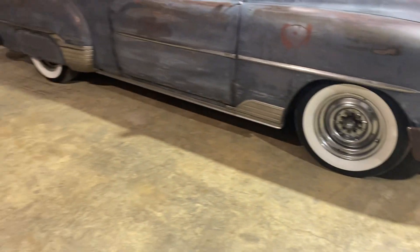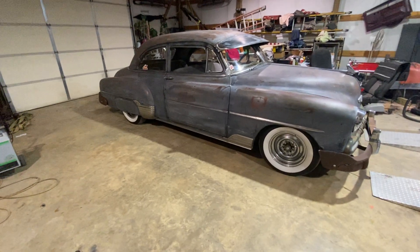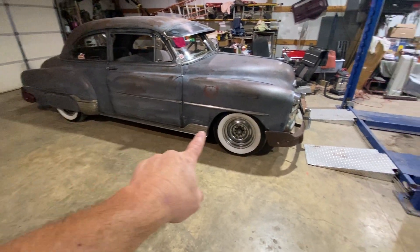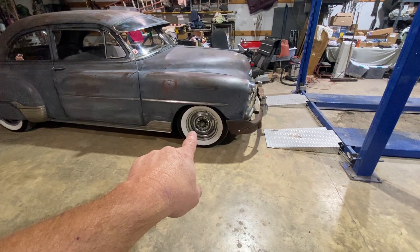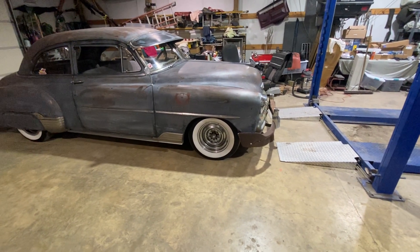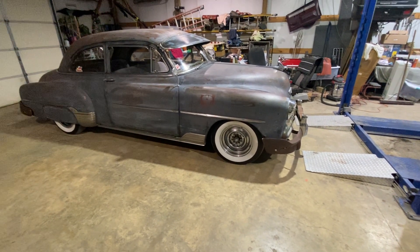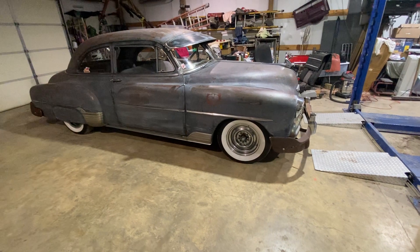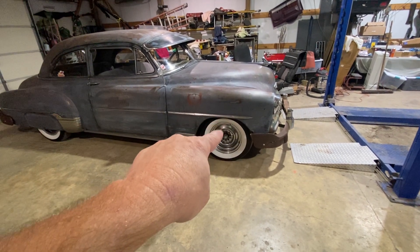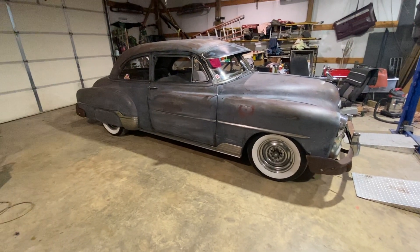So now you can see what it looks like. We'll get to the power plant here in a minute. I've got three-inch lowering blocks on the back, did a disc brake conversion on the front — it's got power brakes. There's still the original front end, original steering and everything, which has a little bit of slack in it. And I changed the front springs to a Moog 85-58 spring — it's actually out of a Ford Ranger — but it gives it an automatic like two, two-and-a-half inch drop on the front, while you still maintain your spring travel. So it works out good.